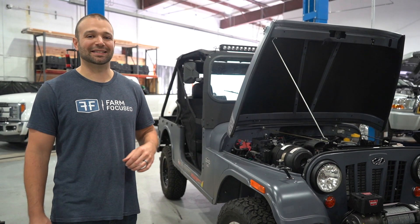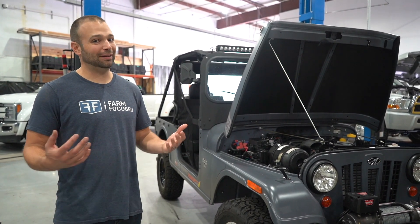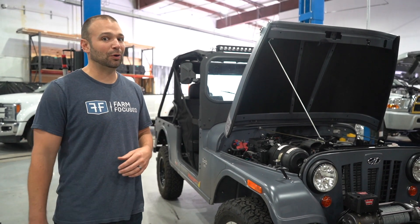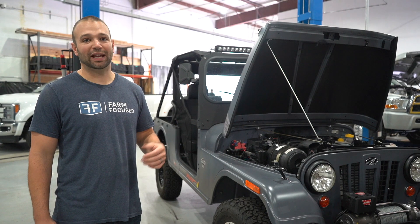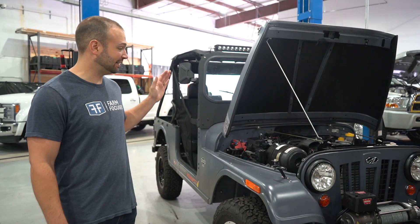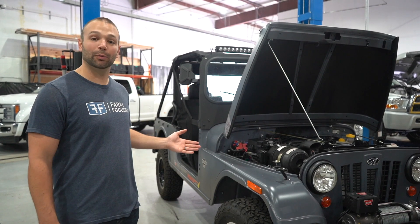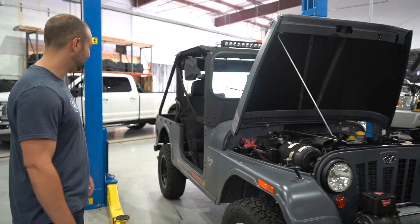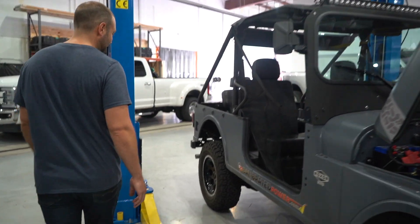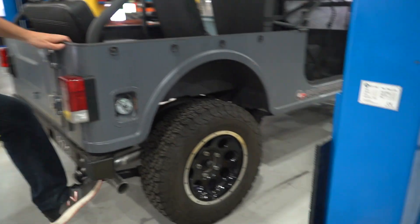One of the things you might find interesting is that the catalytic converter on this thing is not that restrictive. We ran it on the dyno — it was like maybe 2-3 horsepower. It's nice to have the diesel smell gone and the truck quiet, so we left the cat on the truck. I did, however, take the stock exhaust off after, and that was worth almost 10 horsepower. So I had Wade Diesel Freak send me a 2.5-inch aluminized exhaust — got it on the truck, looks really nice.